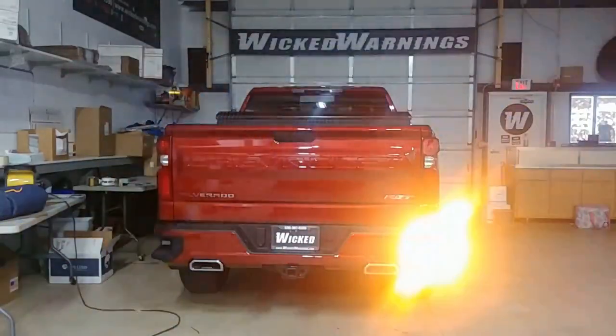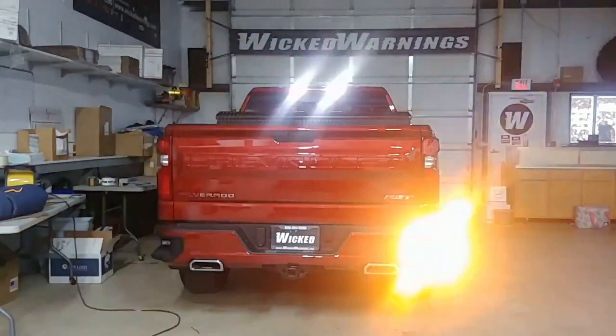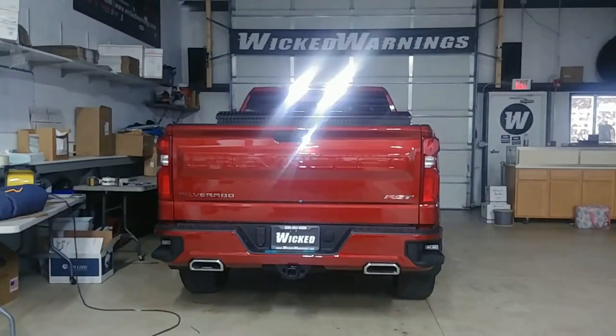Here you can see just the emergency going in the rear, got some nice bright amber down low, a little bit of white up top with a tiny little bit of white middle of the tailgate. And of course, with any auto flasher module, you never lose factory function. As you can see, cargo switch still activates the cargo when not in strobe mode just fine. With all of the auto flasher products, the front DRL, the white mirrors, you never ever lose your factory function. It interrupts it for the strobe portion, and then it returns it right back to factory function, so you don't need to lose any features of the factory.